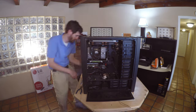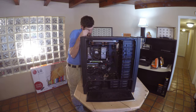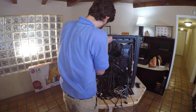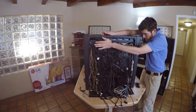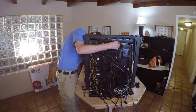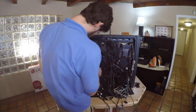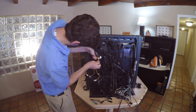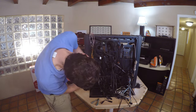Clean up any necessary cabling that's left behind as you begin to organize the final stages of dressing the front side of the case. Now we can begin finalizing all of the cabling in the back of the case. Start with each group one by one and secure them so that way the back of the case can still be closed securely without bending. Remember, neatness counts. It also makes it easier to identify cabling later should there be an issue.